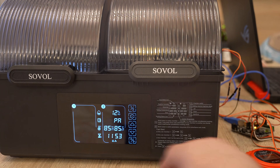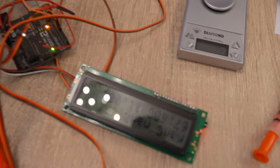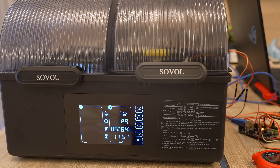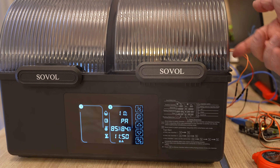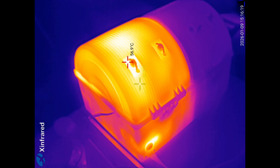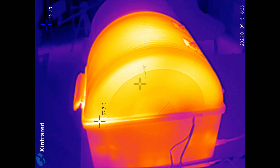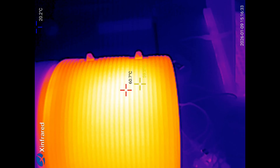After approximately 7 minutes it reached 85 degrees Celsius according to its own sensor, and I could hear the ventilation on the backside opening to let out moisture. But according to my external sensor, the temperature inside is 67 degrees Celsius at 11% relative humidity. The sensors are in different locations so by time these two temperatures should get closer. Hot air is running out through the small gap because I couldn't completely close the lid due to the cables. The thermal camera shows the backside, right side — the lid is partly open — and the front side shows approximately 60 degrees Celsius. Short touch is okay but holding your hand there becomes too hot.